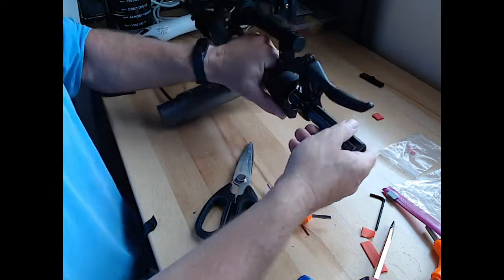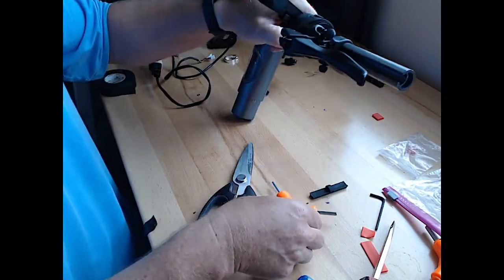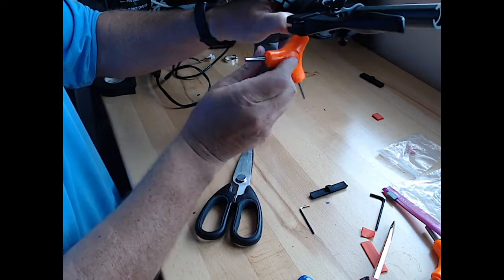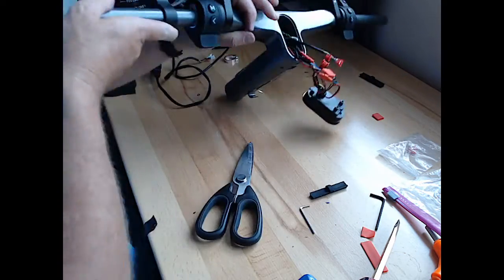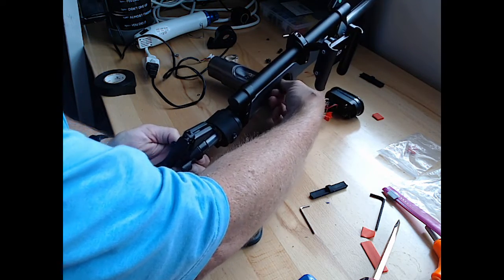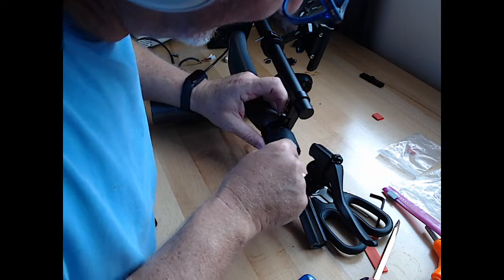All right, let's line this up where it needs to be. Probably about there. Tight. That looks right. Moves freely. Now, cable's fine. This cable's okay. We're going to pull this back out to put the rubber gasket in. So this is what we need to do on the other side too. We just need to loosen the brake line a little bit, and then get this rubber gasket back in here.